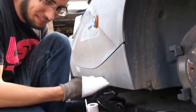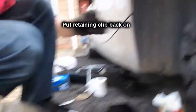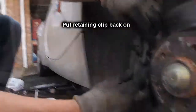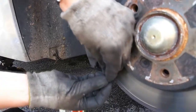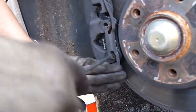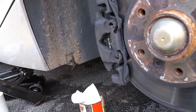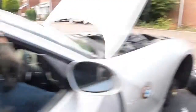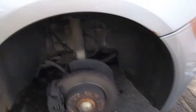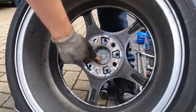Now this bit is a pain in the ass — you've got to force it on. That was easier than expected. Once the pads are in, close the brake reservoir cap and pump the pedals. It'll pressurise the system again so the pads are pushed against the disc. Do this several times until the pedal goes hard. Technically speaking you don't have to do this, but we prefer to do it just to make sure the pedal doesn't go straight to the floor.